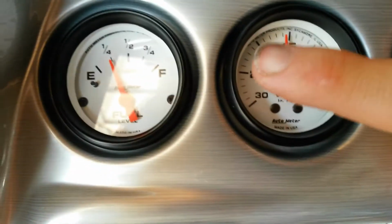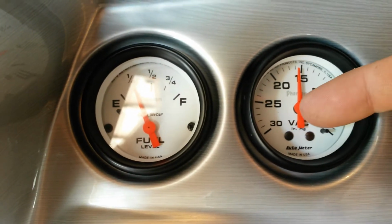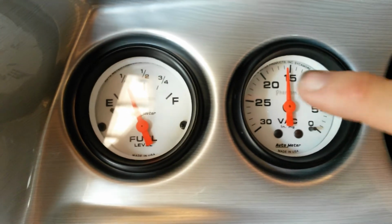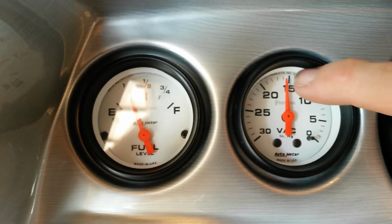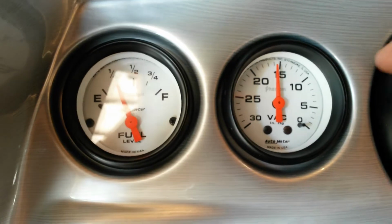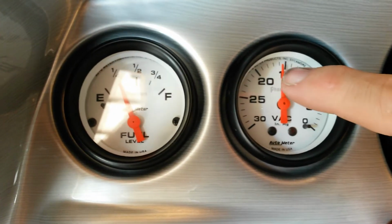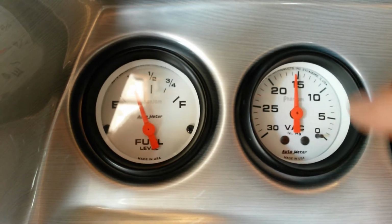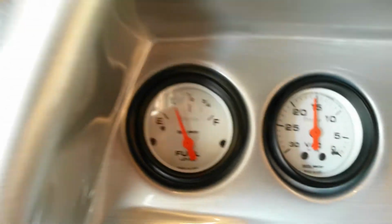So in experimenting with this one, I realized that I could get in from the backside and manipulate the needle so that this is now 0 straight up and down because the engine's off, but it says 15 inches of vacuum. So now everything to the right is boost. Everything to the left is vacuum. I don't so much care about actual numbers right now, but if I'm into the boost, I want to know. And if I'm on the orders of magnitude of 5 psi, 10 psi, I don't know how inches of vacuum relate to psi, but anyways, it gets bigger.